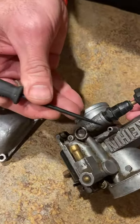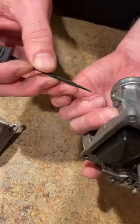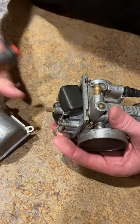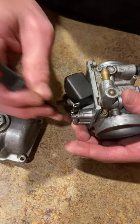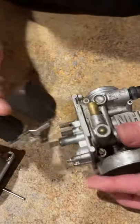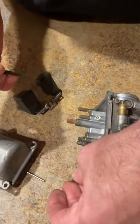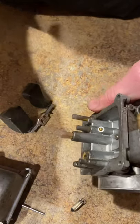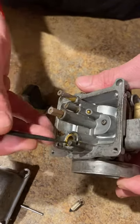If it's too high — I've never seen this personally — it can come out of these ports too, but these are atmospheric bleeds into the carb bowl. If your carburetor is spewing gas out of this tube when you turn your gas on, the float's stuck. Take it apart and clean it. You can take this pin out and your float comes out. It's got a little rubber nipple on it that seats against the seat of the float chamber and stops the gas from coming out. If it's spewing gas once you turn the gas on in the spring, this is all gummed up — take it apart, clean it out, and you'll be good to go.